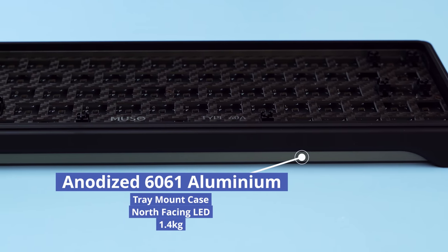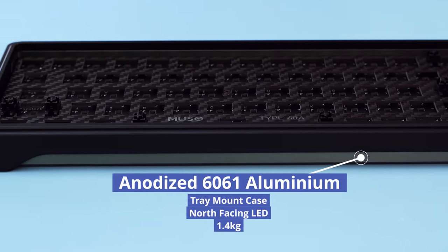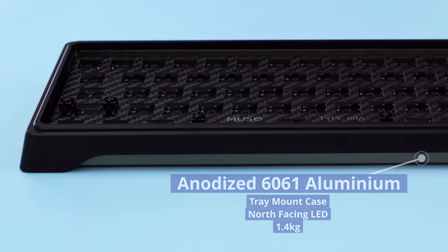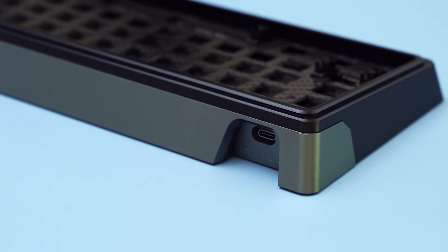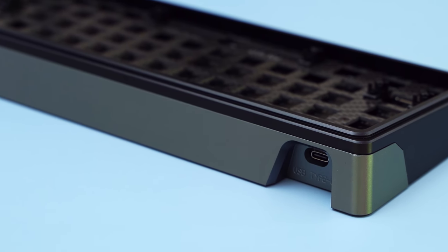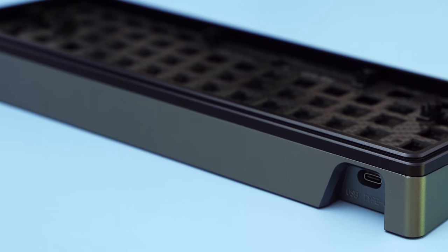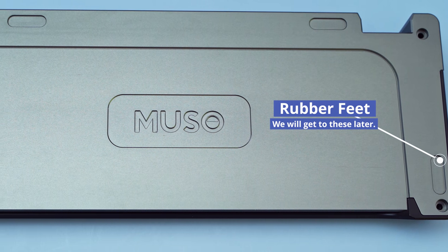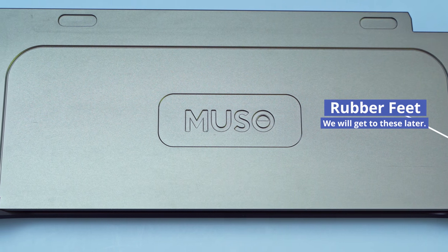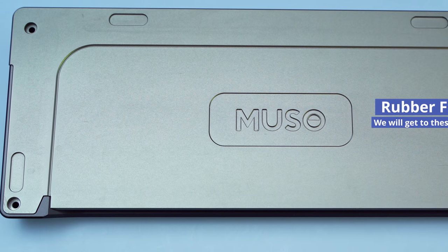As far as build quality for this bad boy goes, this is a really sturdy construction. It's a two-piece construction and uses a tray mounting style. The board is machined from 6061 aluminum and then sandblasted and anodized. As far as quality of the machining goes, this board definitely hits the price tag, and it really looks beautiful with the separate anodization on the top and bottom pieces. This little chonker is 1.4 kilograms, or 3 pounds in freedom units, which makes it heavy, but not too heavy. Moving on to the back of the board, you can see the four holes where the top screws into the bottom, as well as spots for rubber feet. I really like the angles that they cut into this board, and I think the machining is definitely the best part here. It feels a little bit more creative than just a hunk of metal rectangle.